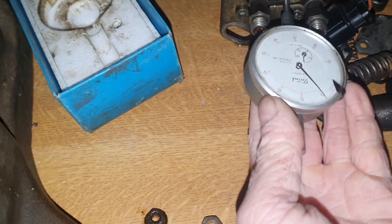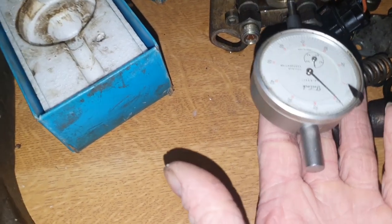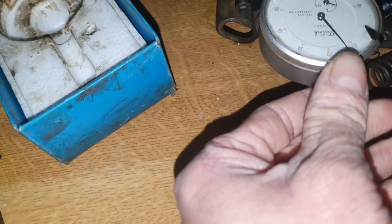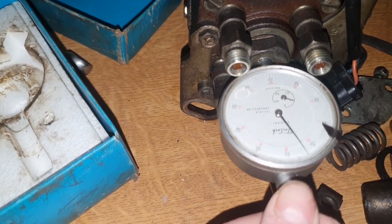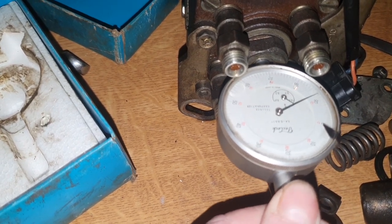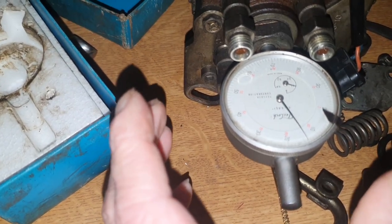This one's in thousandths of an inch. For the Mazda Bongo, it needs to be in millimetres, and essentially that'll sit in there. As you twist the pump, that'll adjust like that. I need to make something that's going to allow this to sit comfortably in there. It doesn't fit too bad, so I think what I'm going to do is just put tape around the edge and have that taped in there, so it's kind of wedged in. Bit of electric tape around the edge — that'll form a nice tight seal. I can just push it in and that should be good enough.